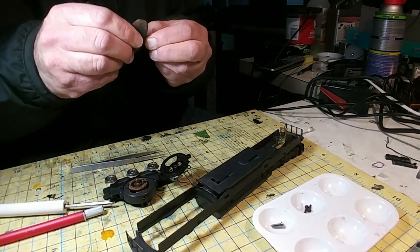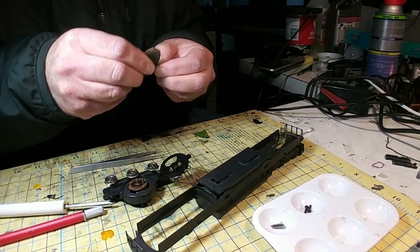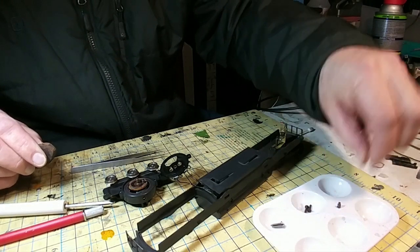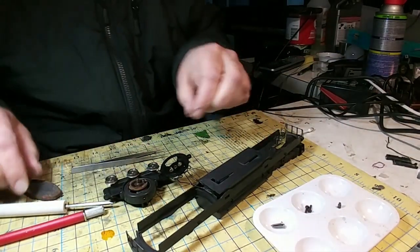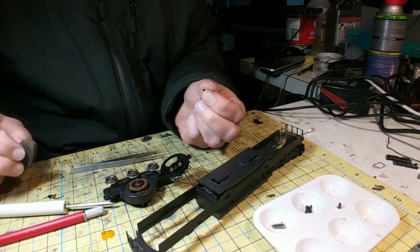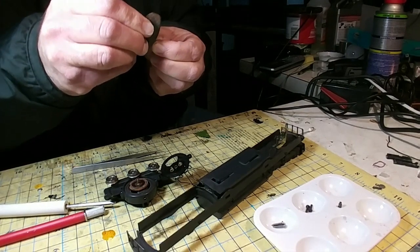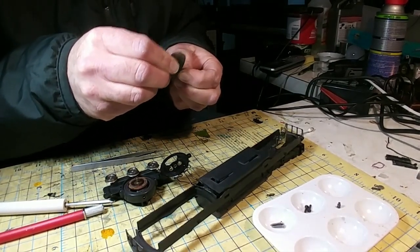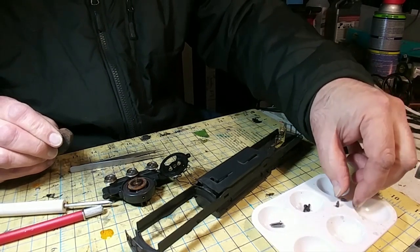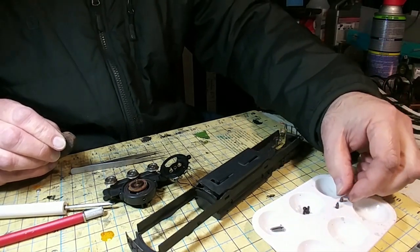But I'm going to take my bright boy, polish that puppy down. I'm going to put that one right over there. We are going to take the other brush and take the bright boy to the commutator end so that it is in better shape than it was. And you are being all flopsy-mopsy, aren't you?